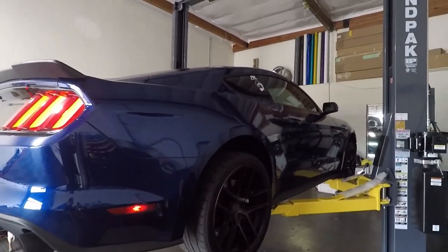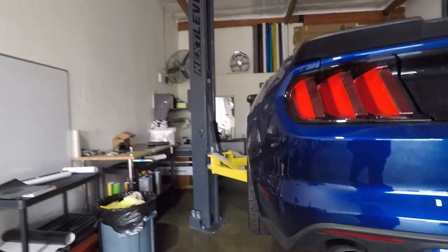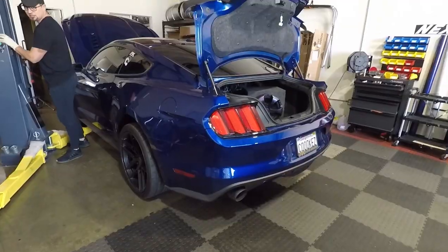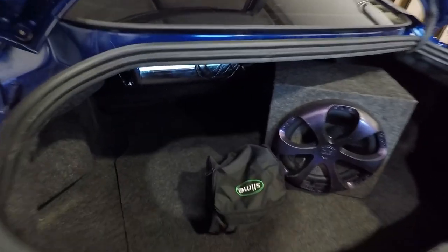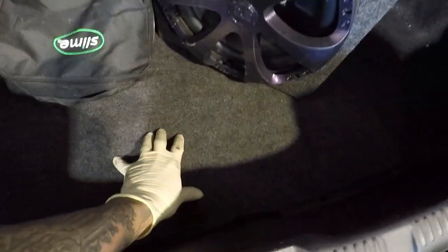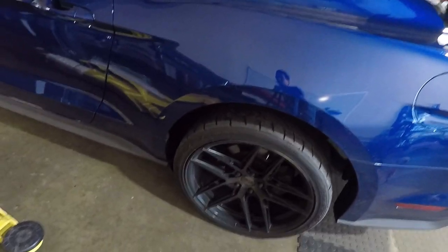We're doing his AirLift 3P system. As you guys know, we're removing everything in the suspension — stock struts. Manny's already getting started on that. We also need to remove his interior to get all the AirLift kit in there. And just like that, it's done — we started yesterday and the entire AirLift kit is already installed. There's a management system and his compressor is mounted underneath, as you can see right there. He's still able to keep everything underneath — his tire repair kit from the factory with the foam piece. We just put the car down and it's currently at about 110 PSI per side.